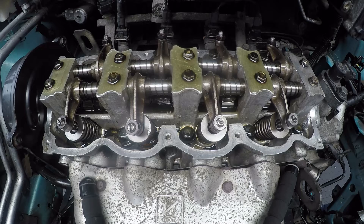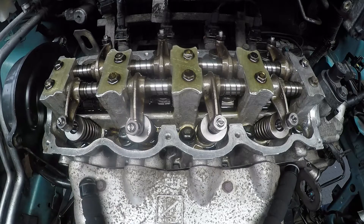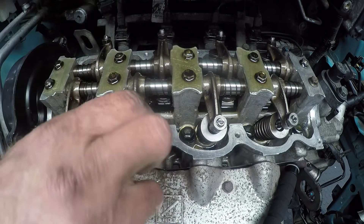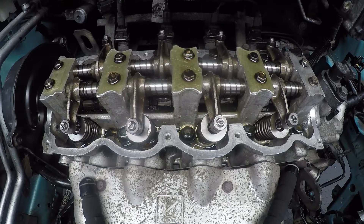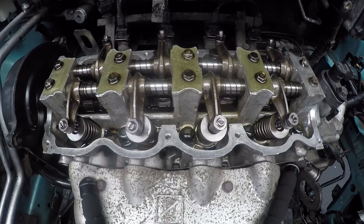We've got number 1 set. Now the firing order for this car is 1, 3, 4, 2. So that means we'll be setting number 3 next, which means number 2 will be rocking. When we turn the engine, we've got to turn these rockers down onto the valves so that they actually activate, otherwise they're going to have too much clearance. Now I'll turn it — you will see the exhaust valve go down on number 2, and as it comes up and the intake valve starts going down, that's where we're rocking. We are now rocking on number 2, which means we're going to set number 3.